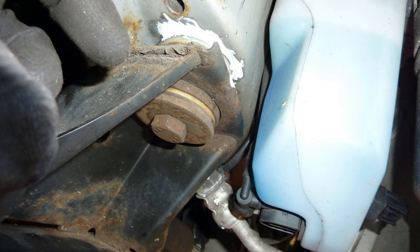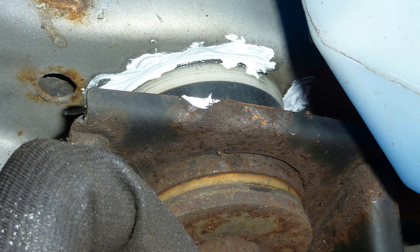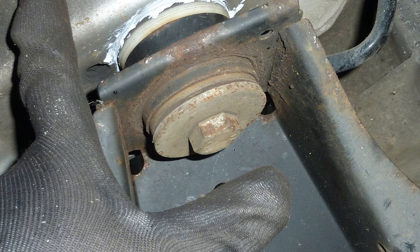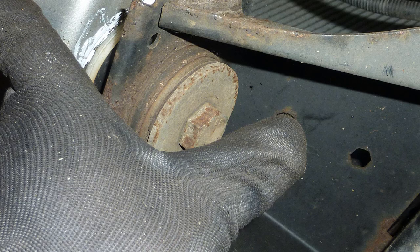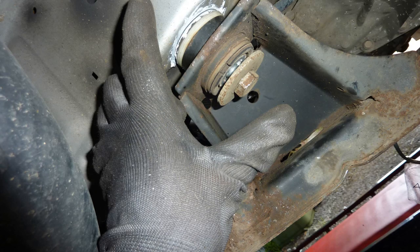Subframe, here is, I painted it, subframe bolts. Indicating this is the right hand side, painting it. So I'm pretty nervous about taking this off, whether I can line it up again. When you take it off, you realise there's a kind of dirt ring around it anyway, and this is a brand new car. And it's obvious where it should go. And it kind of fits, wants to go where you want it to go, if you know what I mean. If it doesn't, give it a boot here and there, rubber sledgehammer it, kick it, and it will sort of go into place.